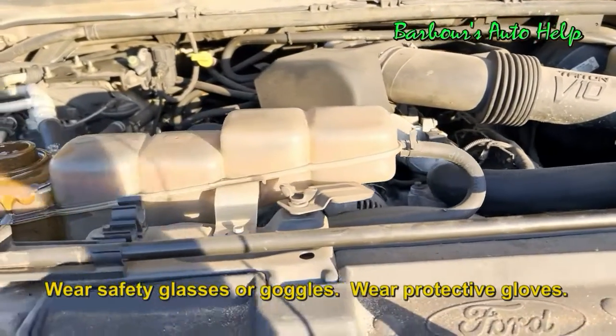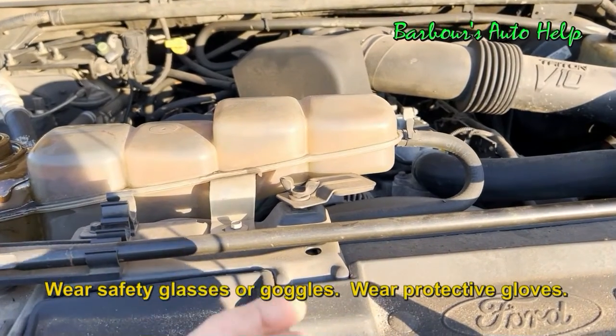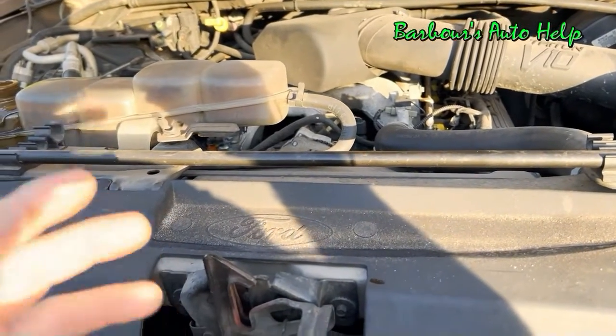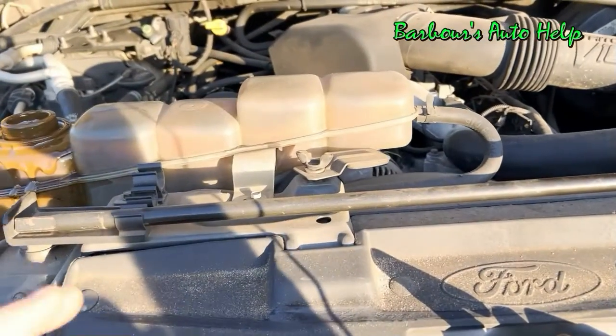You know, this could be caused by a number of things really, like a blown head gasket or a cracked head or a cracked block, and the list goes on. But realistically, the vehicle's running really well. I don't have any misfires. I checked the mode 6 data and I don't have any history of misfires, and it's running well.